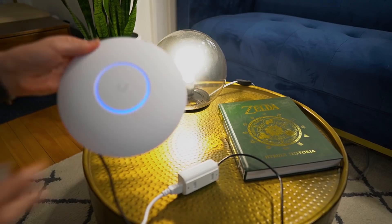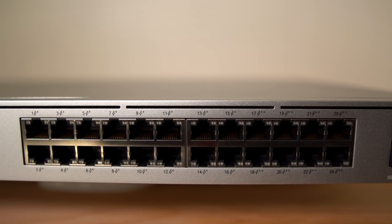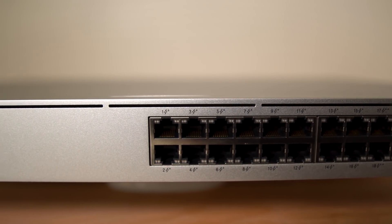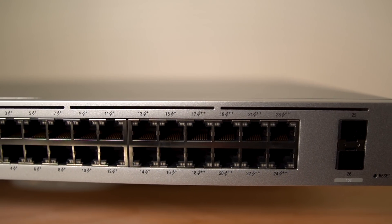So why did I go with this switch over another one? I needed more than 16 ports, so any 16 port switch was off the table. Next, I needed at least 7 PoE ports to get rid of some of the PoE switches hanging off my main switch — this will power cameras, access points, and possibly a Raspberry Pi. And since all ports are powered by some flavor of PoE, I no longer need to worry about which cables are routed where. What finally tipped the scales was the 2 SFP Plus ports, which give me some flexibility.